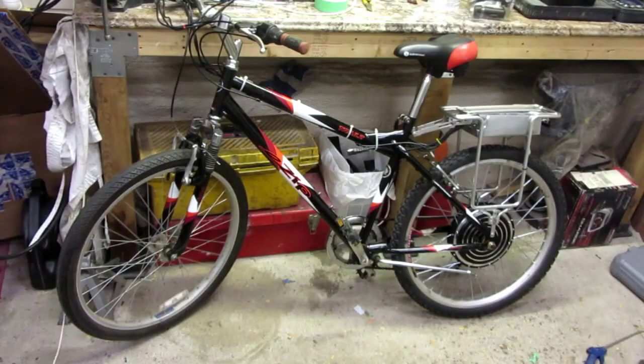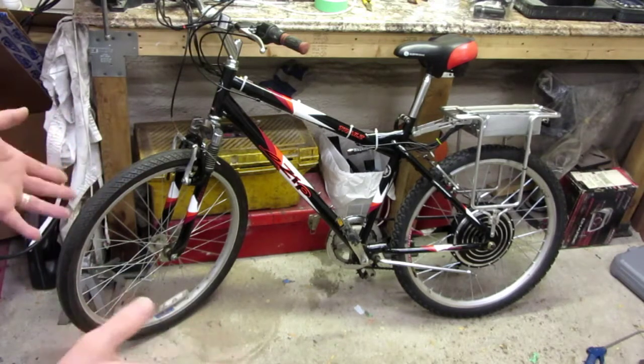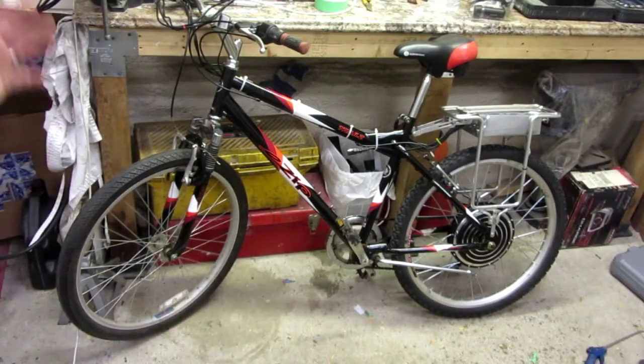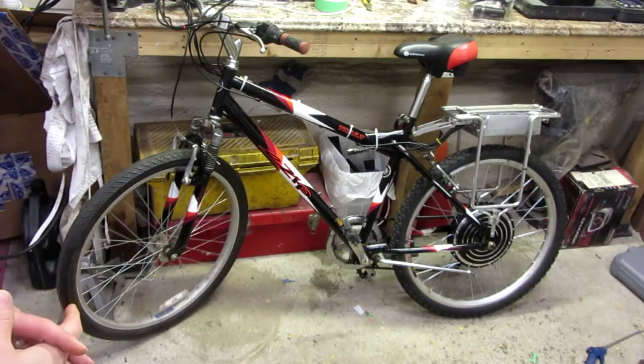Okay, so we got the rear tire on. It turns out that it was flat because there was no inner rim lining, tape lining, so the inner tube just punctured. I guess that's straight from the factory. Anyways, I had a spare tire, so I just swapped over the tire and the inner tape, and now the tire size has changed. That's a knobby tire, whereas the front looks like it's more of a road tire. But anyways, they're both 1.95 inch tires.